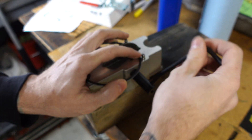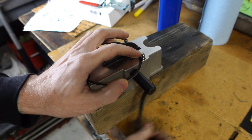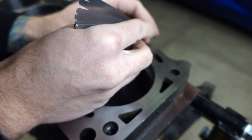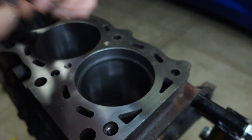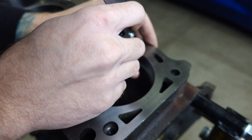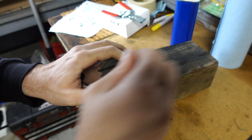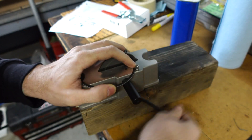This is a simple ring filing tool that I bought from Amazon for about $30, and it seems to actually do a pretty good job. I'm removing only a tiny bit at a time since I can't put material back if I remove too much. After filing the ring, I ended up with a little over 18 thousandths of clearance, which I was good with.